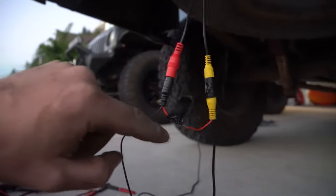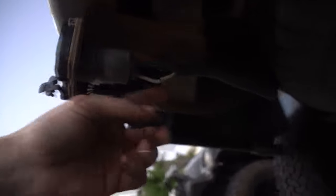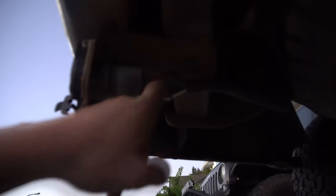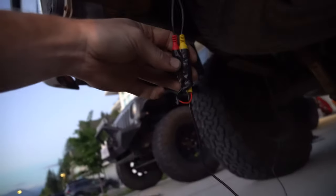Your camera is mounted and hanging here. Tape these two together — red goes to red, tape that up. Right here this big white wire coming off of the trailer harness is a ground, so you can solder it on there, or clean it off with sandpaper until it's dull metal, put a ring terminal on the end, screw it on, and spray paint it black so it doesn't rust. For 99% of people on these trucks there's a trailer harness on it, so might as well just throw it on — ground going there, power looped there, and now let's go try out our backup camera.